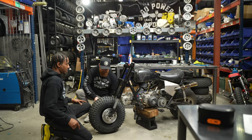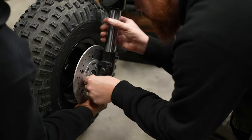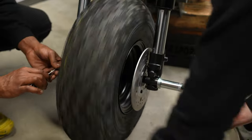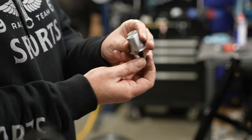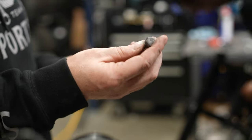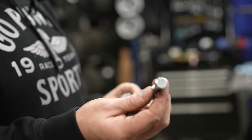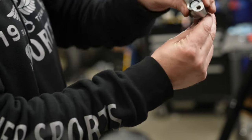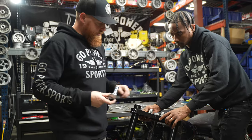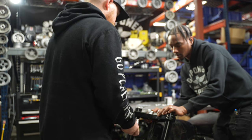We are now installing our front wheel setup back onto the MB200. We're going to put the stock MB200 risers back on here. This bolt you will have to replace — it's a little too short to get all the way through the billet triples. A 3/8 bolt you can pick up from any hardware store will go right in there and fit like a glove. Leave these a hair loose until we get the handlebars on, then snug them up.